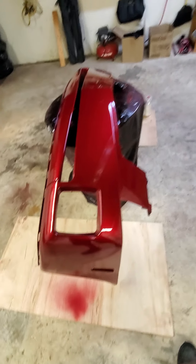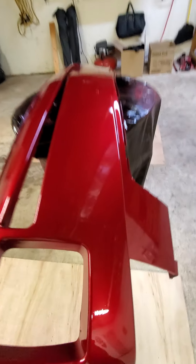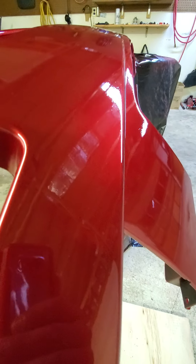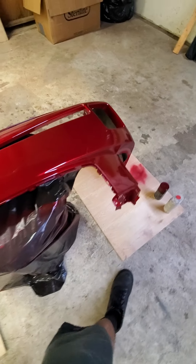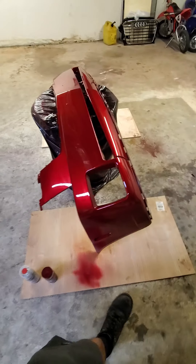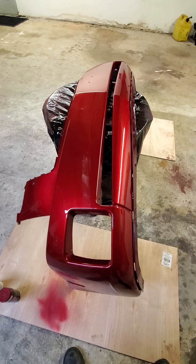The clear coat came out thick, it was really thick. You gotta know how to spray it on, but that stuff is some real good spray paint. This is how it turned out and I love the results. It's super clean, super clear. This gloss coat is amazing — as you can see you can see my reflection off of this gloss. I can't wait to buff this out, wet sand it, get the orange peel off and get this thing nice and clear.